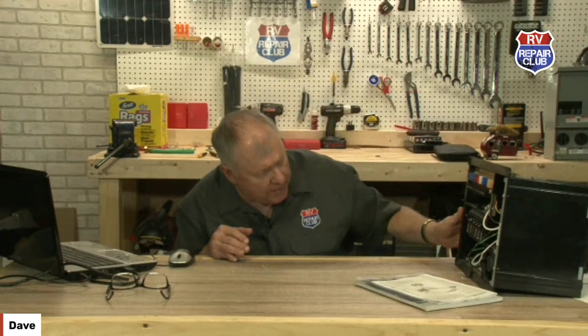So once you figure out the battery, the next thing is you got to look at your charging system, which you have done. And the typical chargers are going to, like this one here. This happens to be, I believe, Progressive Dynamics. Anyway, the one that we're working on is a WIFCO. It's like this, the all-in-one distribution center converters, which is your battery charger, are going to do about 13.6 volts. And the lithium batteries want 14.6.